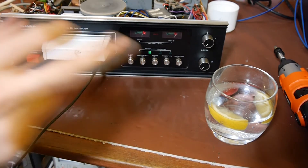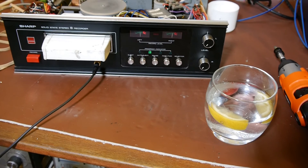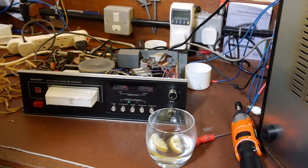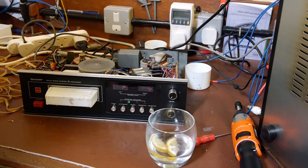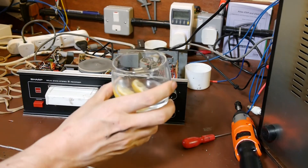I'm wondering if the problem is just that this amplifier is expecting a different output level. I'm just going to put my microphone up to the headphones and you'll probably hear it louder than from the amplifier. It seems strange there's no way to adjust the headphone output level. I've found another lead in the box of junk — a DIN to phono connector — and I've connected this directly into the amplifier's auxiliary input. The volume level has come right up now, so I guess it was just a problem with the leads. It's all working now — that'll do. Cheers everybody, bye bye for now.